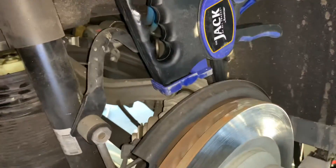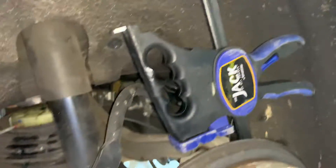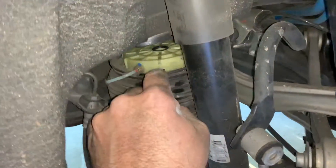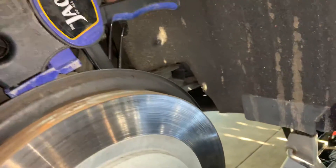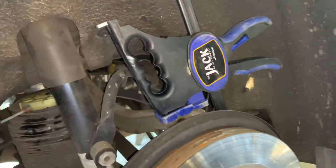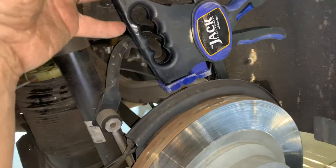This time I'm doing the passenger side and you can see I've got a jack pushing up against the wheel. So it doesn't take much. What I would actually do is before you even drill out the top of the strut and release the air, I would just put a jack in that place and get it so that it's supporting the tension. And then when you release it, when you blow the thing, it will not be able to compress anymore.